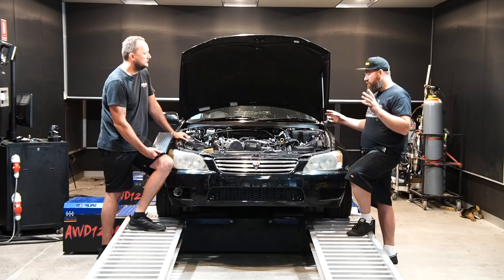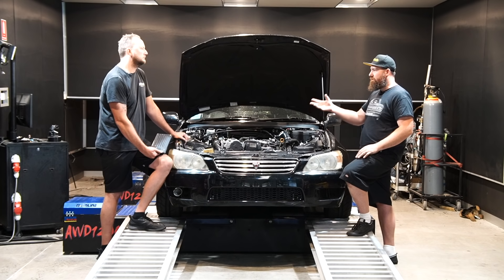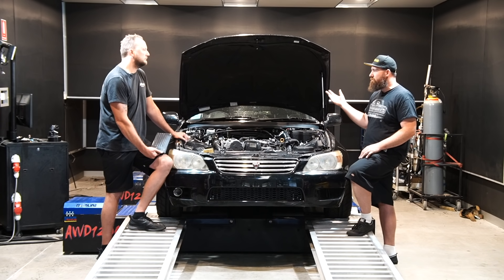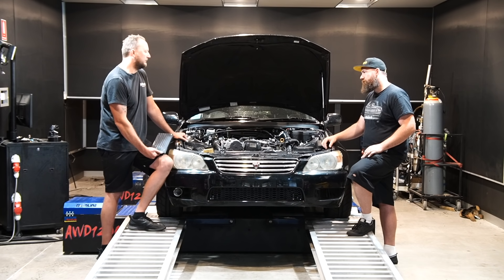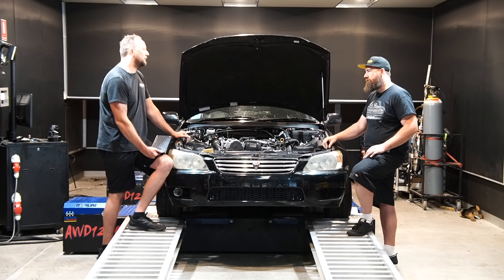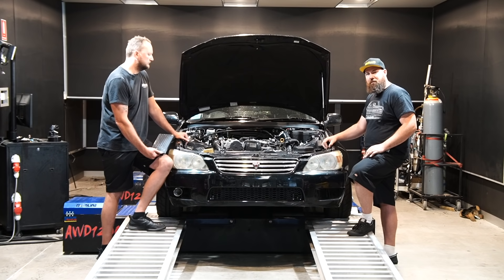Interestingly the 50% throttle run with the current supercharged setup was almost exactly the same power as it used to have naturally aspirated — so that throttle body is obviously very well sized to this engine from the factory, Toyota got it right. We didn't need to put a bigger throttle body on — no reason or need to. Throttle body size is a funny thing: bigger is definitely not always better, it makes them drive worse and doesn't always pick up power. You can see it with something like the Cresta running a factory FG throttle body — 72mm — making over 1200 horsepower. If you put a pressure sensor before and after the throttle and measure the pressure difference, leave it alone until there's a measurable drop. Thanks for watching guys, we'll see you next time.